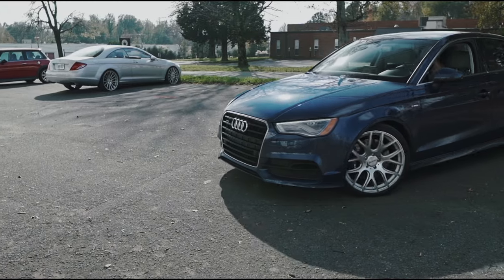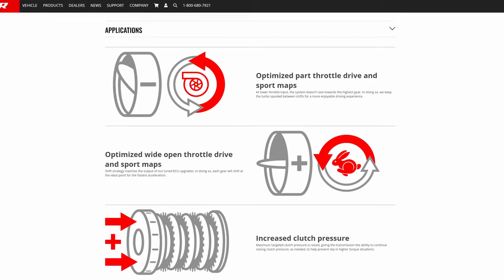For any of you that don't already know, the Audi S6 and S7 use the DL501 DSG transmission. From my experience driving different DSG cars, this model doesn't feel quite as snappy or responsive as what I'm used to coming from a 2-liter car like my A3, which had the DQ250 trans. But I will say I'm pretty well satisfied with what we're getting out of the APR DSG tune. It does feel a lot more responsive — not quite as snappy as the 2-liter cars, but it does what it needs to do. It's still really quick. Definitely happy with the DSG tune. You've got less delay in the paddles, and of course you've got that clutch clamping pressure so you're not going to have slippage.